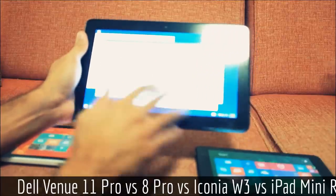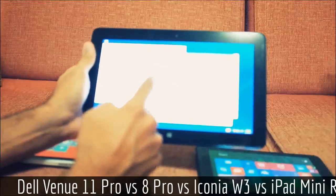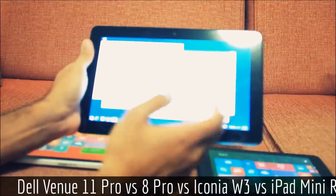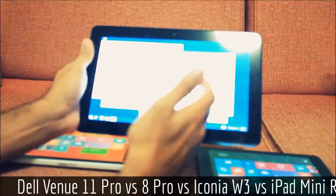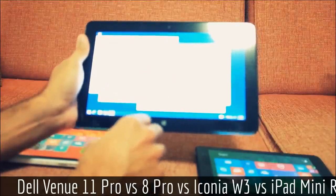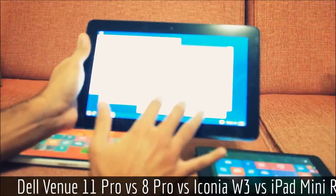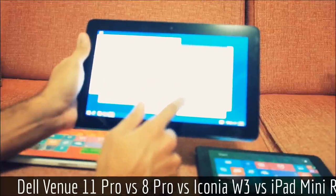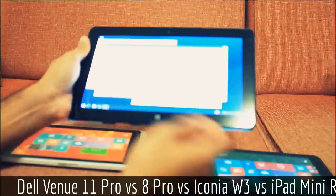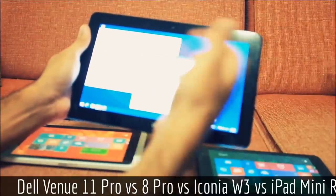It does support an SD card. Here you can see the partition layout: it's got a 500MB EFI partition, a 40MB OEM partition, a 2GB recovery partition, a 50GB Windows drive, and another 5GB recovery after that. So it's only about 30GB free when you get it. I've actually made my SD card bootable with an EFI partition — if there's interest I'll teach you how. You can also potentially offload some apps onto the SD card if you know what you're doing.